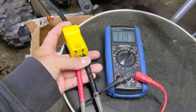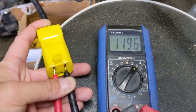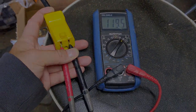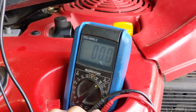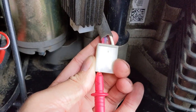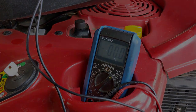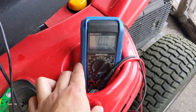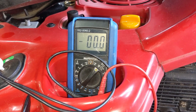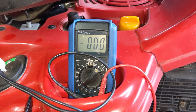Just to show that the multimeter is working properly, I tested an extension cord and confirmed we read 119.7 volts AC on a 120-volt circuit — so the meter is accurate. Because we were only getting 0.1 volts AC, that is a fail on our first red wire coming from the alternator. I then flipped the connector and tested the red wire next to the white wire — firing up the engine at full RPM — and again we got 0.1 volts AC. So on both tests we had well below the recommended spec of eight and a half to 10 volts AC.